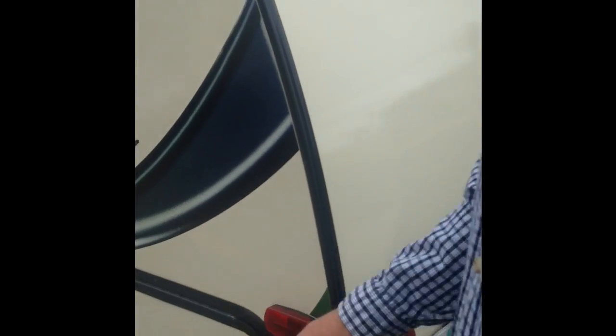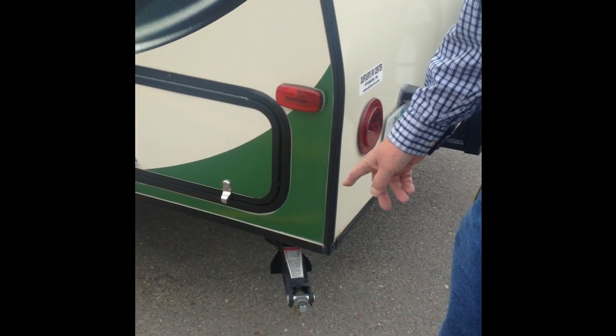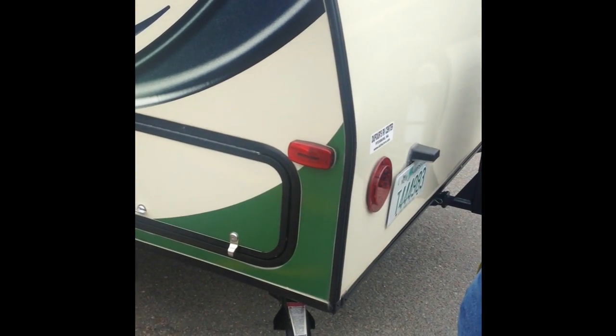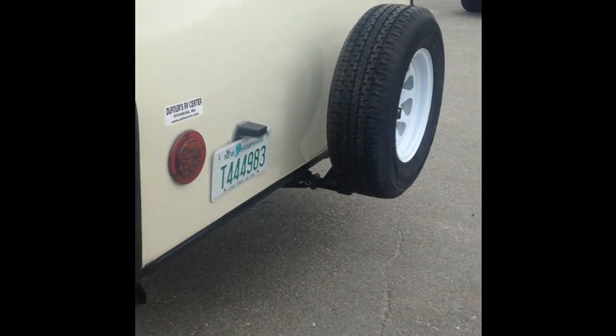Back to stabilizing and leveling — once you do the leveling side to side, you can unhook and then level front to back using the jack in the front. These corner stabilizing jacks are not for leveling the trailer — they're not strong enough for that. Once the trailer is actually leveled, just crank down the stabilizing jacks. On pavement you're generally fine, but on soft ground carry a few squares of plywood or use extra Lynx Levelers underneath the jacks. There's a wrench for the jacks stored in one of these compartments.